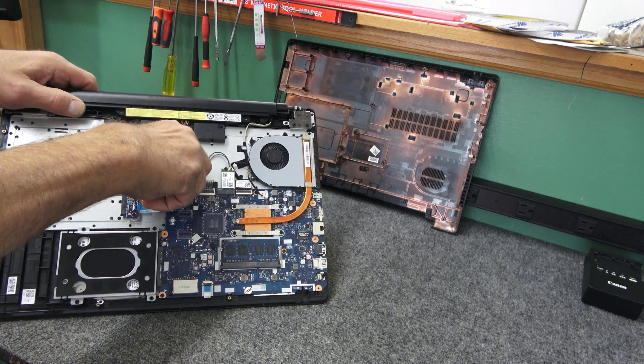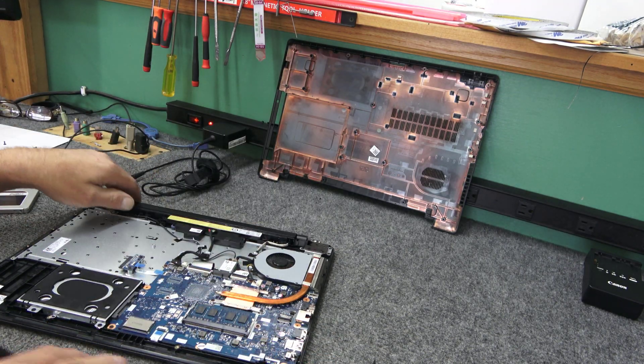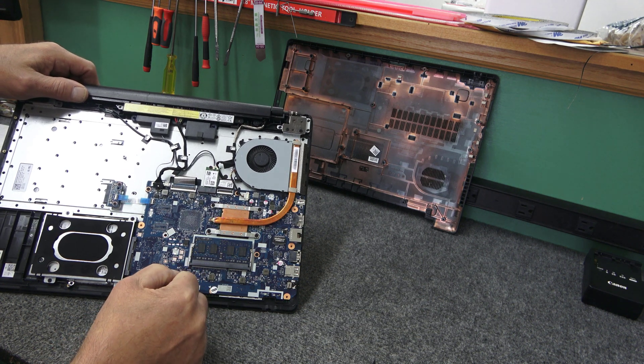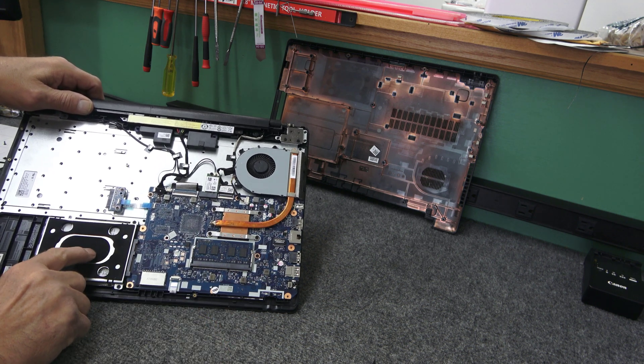You can see that — just don't drop your tools or screws or go poking and touching stuff. There's one stick of 4GB DDR3L memory, just the one slot. You could put an 8GB stick in there, but I'm not going to do that today. Just going to put the new SSD in the caddy.